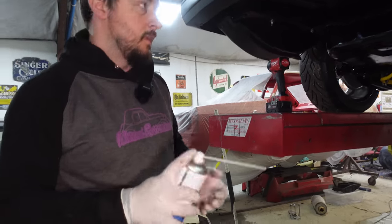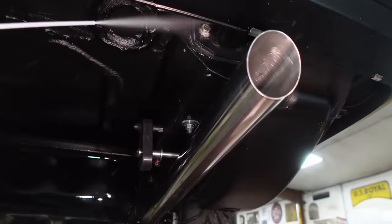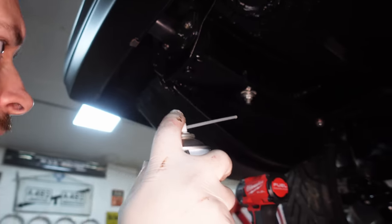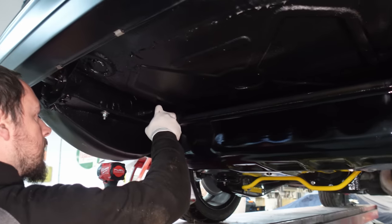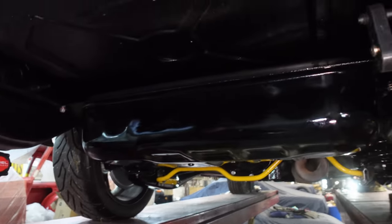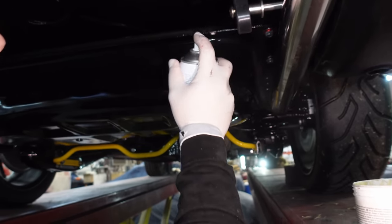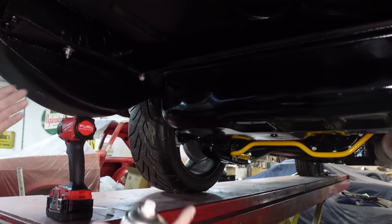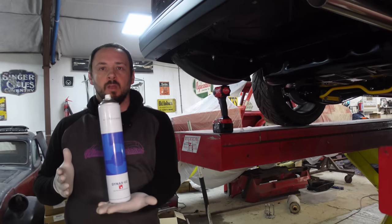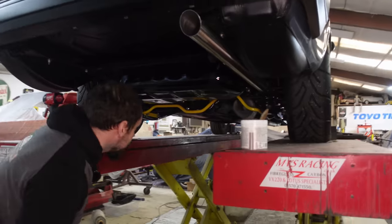There's also a really short one for concentrated bursts for the more harder to reach places. The fuel tank's a bit of a spot for corrosion on 240s — the whole tank is really exposed and the front of it gets hit with more water and dirt than you'd think. And around the edges because it's a two-piece metal with an open seam, you really need to get it in these edges to protect that. I will put a link to Dynax in the description. Not a sponsor — we just love them.